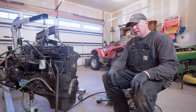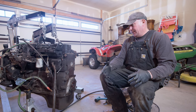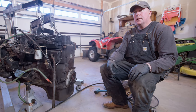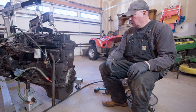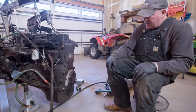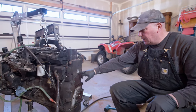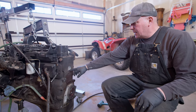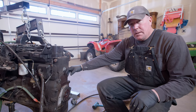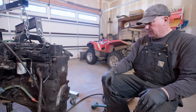The motor's got about 140,000 to 150,000 miles. It's all original as far as I know, and it's a 1990, so it's about 34 years old. For a Cummins 12 valve, that's not horribly bad. While we're this far into it we're going to do that, and I also bought a rear frost plug upgrade — it's supposed to solve the problem with these popping out. We'll throw that on, throw the rear main on, and then put new parts on it.